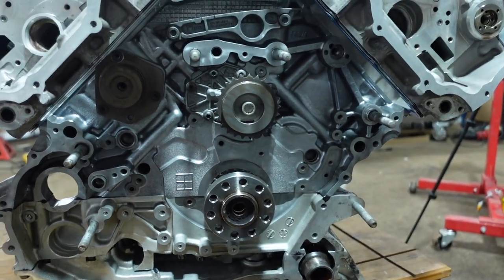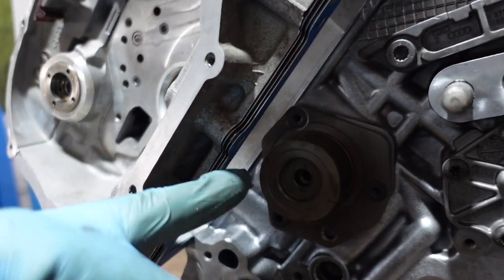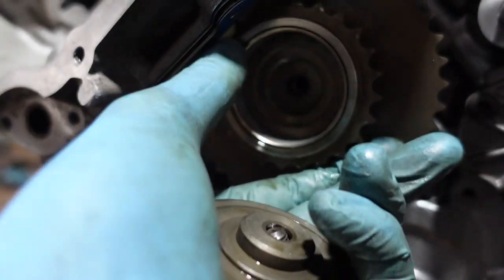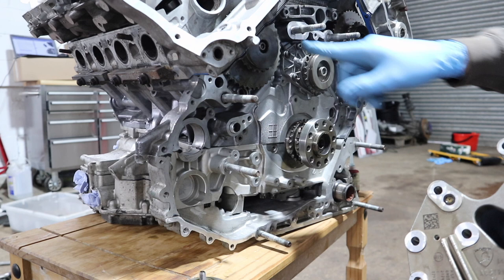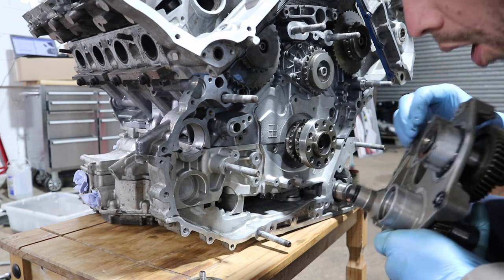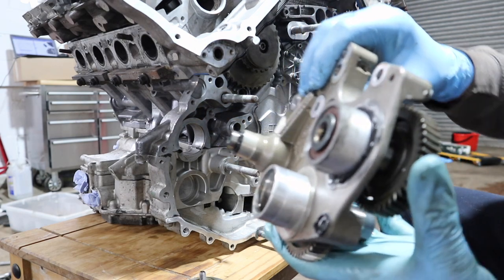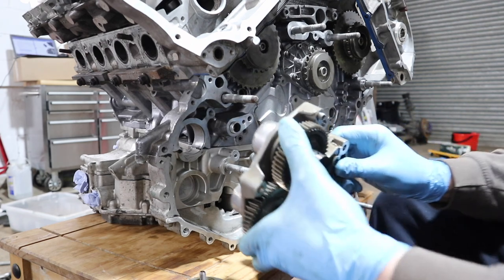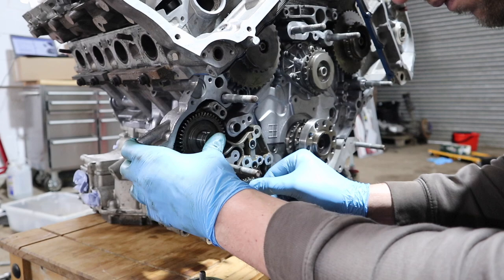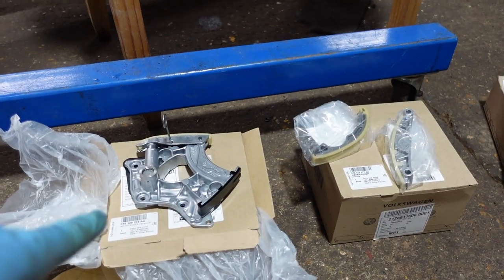I've just had my first major panic - I looked at that and thought 'oh no, I've put the head on, is this going to fit?' - but luckily it was a very close call. I've got the sprockets for the timing chains for the cylinder head, and now I'm putting the spur gear oil pump drive in. I had to put a bead of silicon around here because it's sealing on an outside surface. That's the spur gear all fitted and torqued up - you can hear the oil pump drive nicely in.